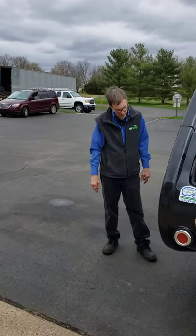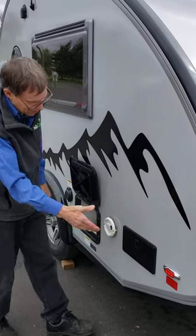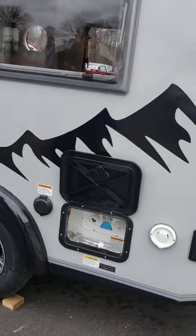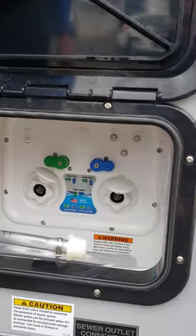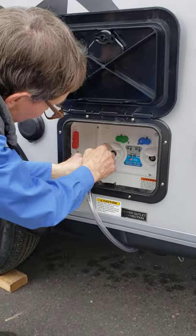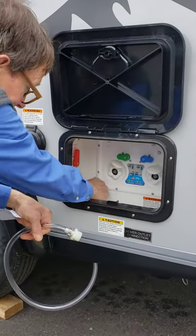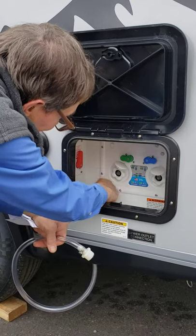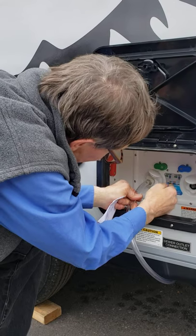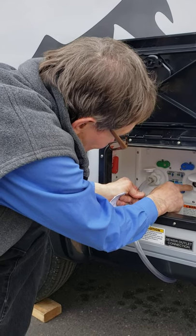Over on the side we have the familiar outdoor shower, now in black instead of white, which makes it more attractive with the graphics and the silver. Here we have the new Nautilus 2.5 — your water center. This could be used to winterize from the outside. You have a switch to flip on the pump, which is really nice. You can simply drain, bypass, close your drain valve, and screw it to the winterized position — it tells you where everything needs to be done. Valves are given indications for filling the tank, and you would fill the tank right through this valve.